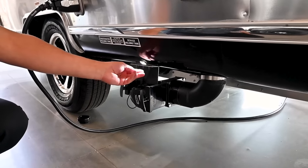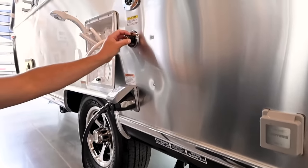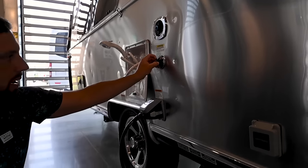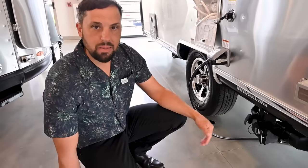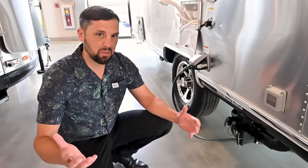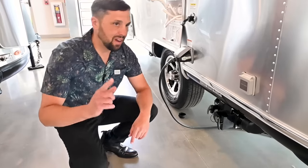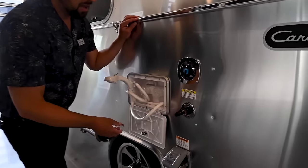There's a light so you can see what you're doing at night. The trailer also has a black tank flush — after emptying the black tank and putting it in storage, take a regular garden hose, remove the cap, stick it in, and run water for three to ten minutes. There's a wand and jet inside that sprays the walls down. Make sure the handle is all the way open when the water is on, and don't build up pressure in the tank — you don't want to overflow it and flood the inside. The connections are labeled, so it's easy to do.